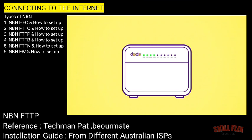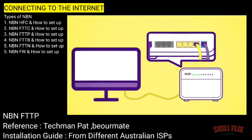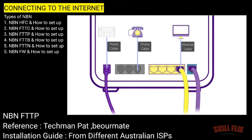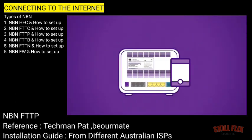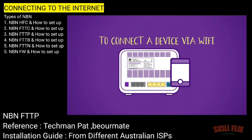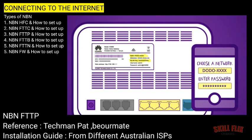After this time, these are the lights that should be on. If you'd like to connect a device via a cable, connect the ethernet cable that came in the box into one of the yellow LAN ports in the back of the modem, and the other end to your device. The LAN 1 light should now be on. If you'd like to connect a device via WiFi, use the SSID and WLAN key on the back of the modem. Simply select the SSID, which is the network name on the list of WiFi sources on your device, and type in the password, which is the WLAN key.